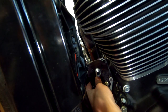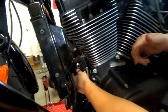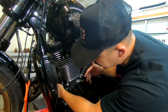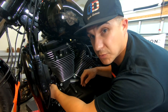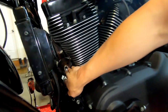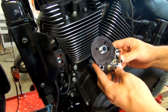the case. Well, we're not gonna quite put it against the case because if you're watching our channel, you own a Harley and you know that this thing is gonna vibrate a lot. Harleys vibrate a lot. So we don't want this bracket to be digging into the case. So we're gonna leave just a small amount of room, like maybe a quarter inch or less of room. So next thing we gotta do, we got it to where we want it. We have to tighten this down and then we'll install the outside of the adapter.